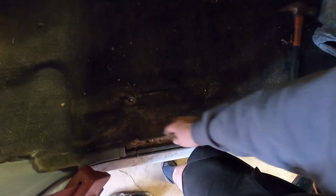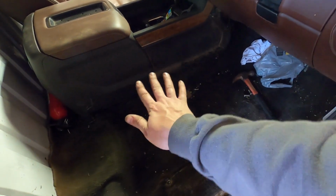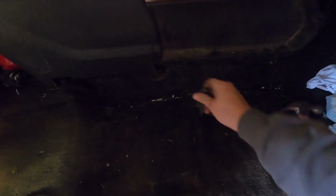I would set the seat down in here. Since your outers match the factory holes, I would set it down, get the bolts just started on the outers, and that'll at least get the seat straight, to where it's not wonky one way or the other. It'll get it where it needs to be forward and back for the brackets. And then you can go in here, and what I did, since I have deadener on the floor and deadener kind of smushes, I set it in here and then put this through the bracket hole. And since I don't have cushions and all that, I could reach. And I just applied pressure to this pin, and what it's going to do is put an indention in the deadener in the floor, and I'll know where to drill my hole at.